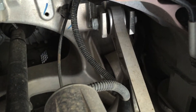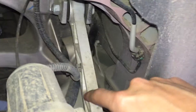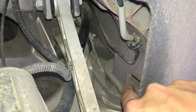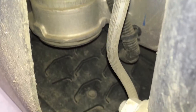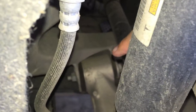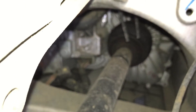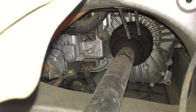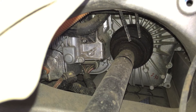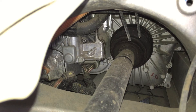I turned the light on for a better look. This must be some kind of control arm — looks like it's made out of aluminum. You can see the wiring for the park brake actuator, and there's the electronic actuator in the park brake itself. There's the brake line, and that's part of the big subframe assembly that houses all this stuff. There's plastic shielding on the bottom. That back there would be a lower control arm, and this would be your CV shaft or axle shaft. Going back further, that must be the drive unit — I've heard of other Tesla Model S drive units going bad, and I think that might be what that is.